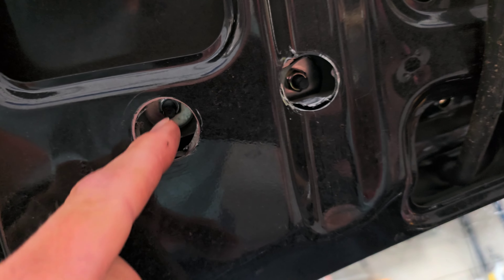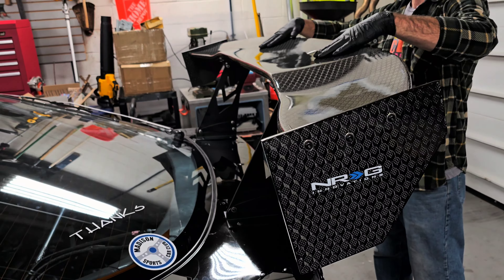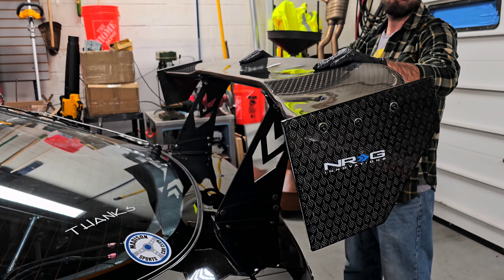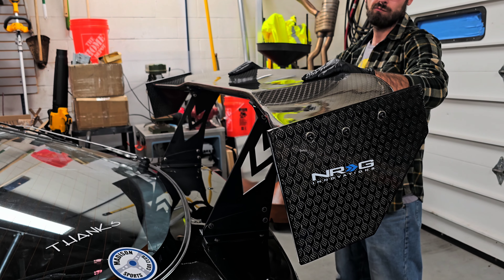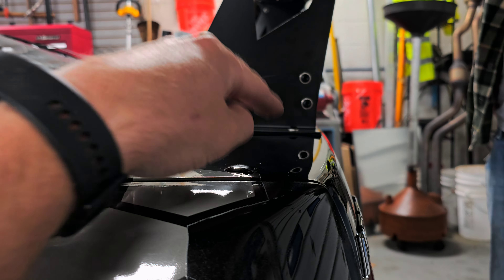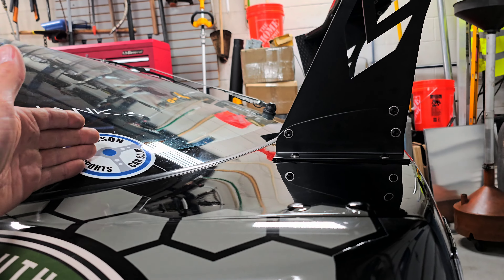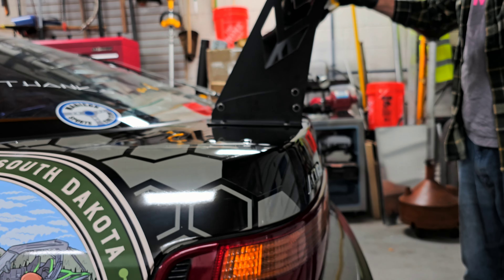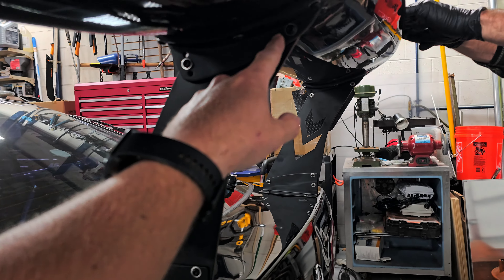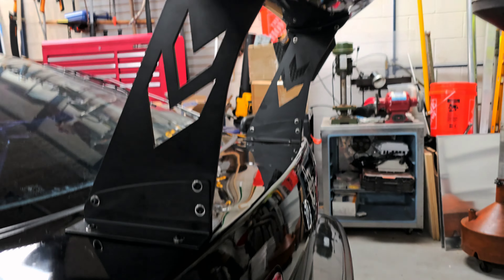All I've got left is to put the trim piece back on. For our last test, I want to show you guys the deflection with the trunk — Cody's going to pull down on it so we can see how much flex we have. We do have a little bit of deflection. The trunk is flexing, and this is actually a very stiff trunk for what it is because there's not a lot of material and it has heavy thick glass — most people's trunks will probably flex even more. What I'm probably going to do is use Professional Awesome's splitter rod kit, mounted off the back bolt and down into the vertical portion of the trunk, to help with the deflection. That kit is about $108 to $110.